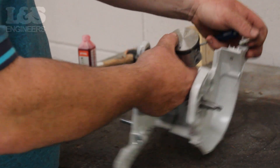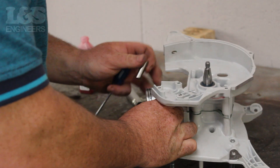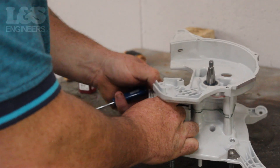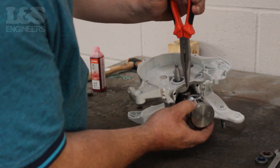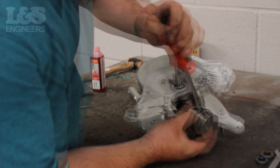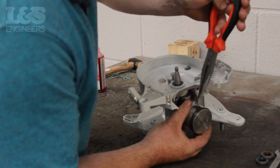Place your new piston over the crank and turn the engine on its side. While on its side, push the pin through the centre of the piston. Then using the pliers, place the piston spring back into position. Ensure that the spring is secure and in the correct position.